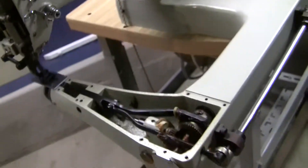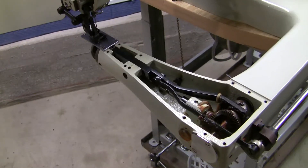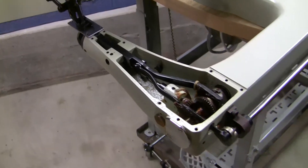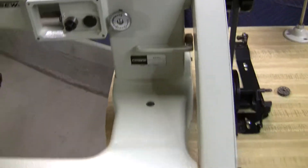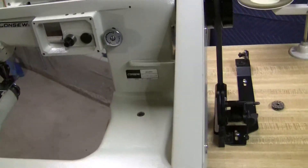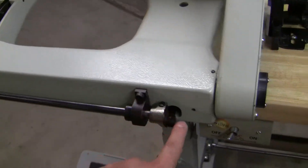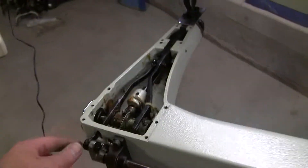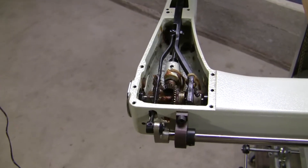Since it's off the arm, there's an incredible amount of gears and levers to adjust it. It runs a belt in there — you don't have to service it, there's no oiling or anything for it, so you just keep that sealed up right in here. And then there's a bar that runs inside here, and here's another bar that comes off from a cam in there that moves it back and forth. That's for the walking foot for the lower feed dogs.